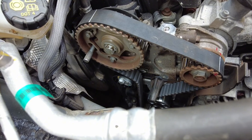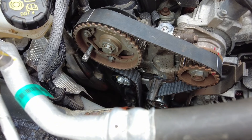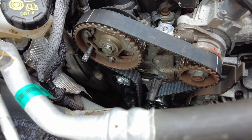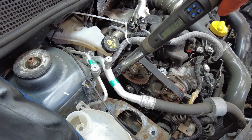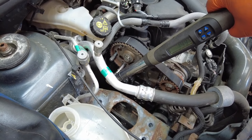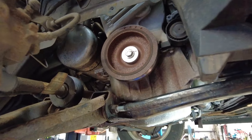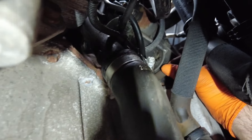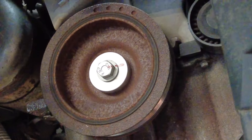Before we tighten that camshaft up, we're just going to put the crankshaft only on — by hand — to make sure everything is absolutely bang on. Once you're happy with the tension on the belt, go ahead and get that camshaft pulley torqued up to 14 Newton metres. Now the crank bolts do need torquing up to 120 Newton metres and then 90 degrees. I've left the locking pin in the crank to do this — it's not going to bend it or cause any problems.